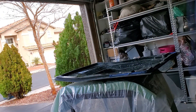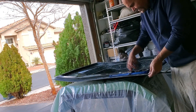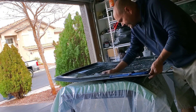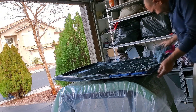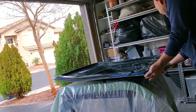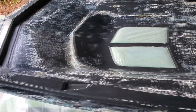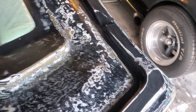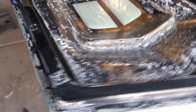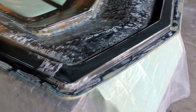Okay, I'll wash this up, wipe it down, and then go over it with a fresh microfiber towel and some wax and tar remover. This will get up all the big stuff. Come back over it with the wax and tar remover. You can kind of see the mess we made. It's nice and smooth though — smoother, anyway. There are some places down in here I'm not really going to care about, but that's one step closer. I'm going to wipe it down with the wax and tar remover, let it dry, and come back to primer it up.